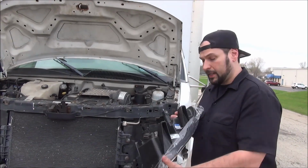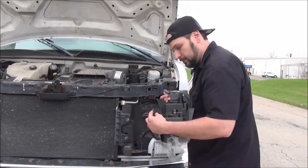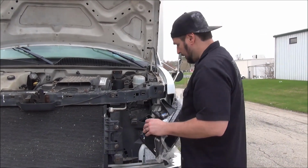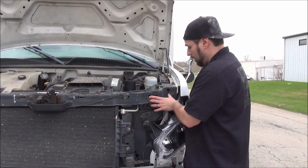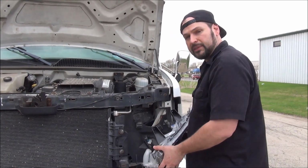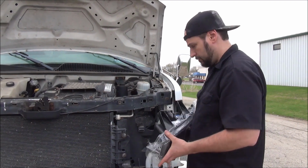And now that we've got all that cut out, we can basically just slide this sucker in. These little guys just kind of hook on the bottom, pretty simple. And then there's two bolts that hold the actual headlight on, here and here. We got to put speed clips and a couple of 10mm bolts. I'm going to put the part numbers for those bolts in the description.